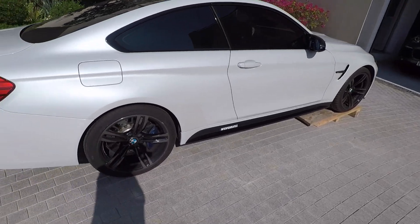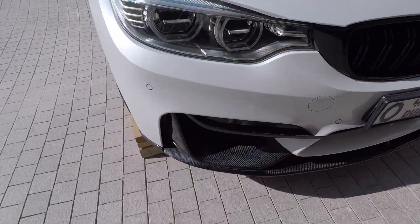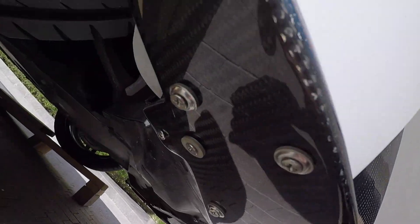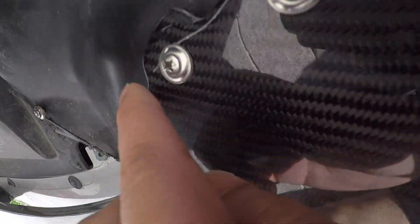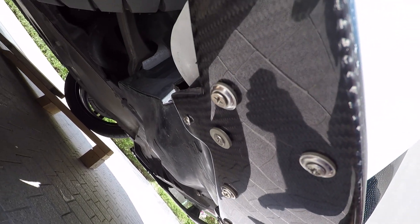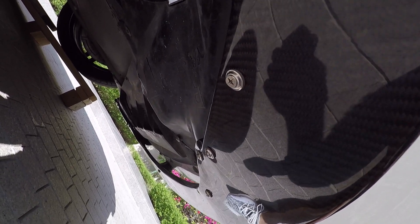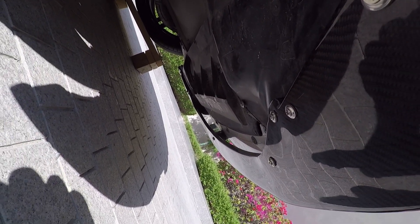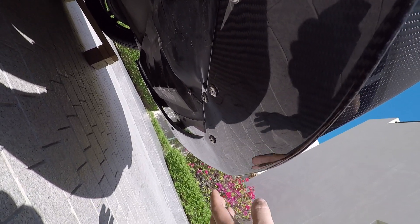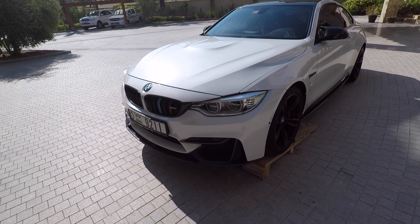If you want to see how the bottom was done, it's just nails with support washers. The most important part is making sure these two go directly into the existing holes that BMW put in — make sure they match. The rest just go into the bottom body of the car. Just be aware that you will need to drill through the bumper. If that upsets you or you're not interested in doing that, then don't go for the lip. I think it makes the car look a lot nicer — I've had the car without the lip for a while and I'm quite happy to have it back.